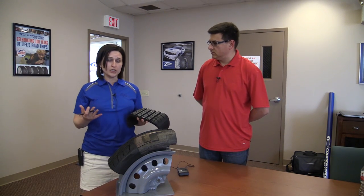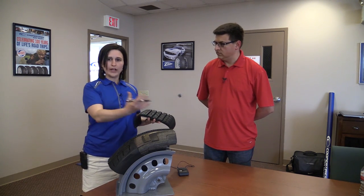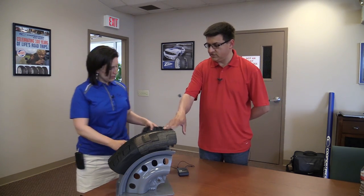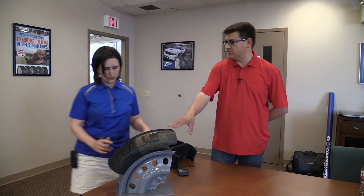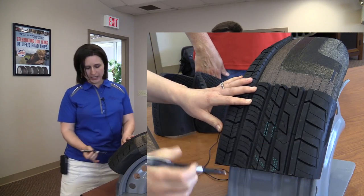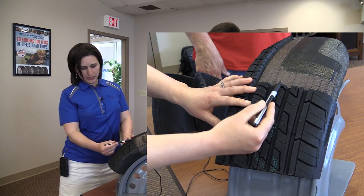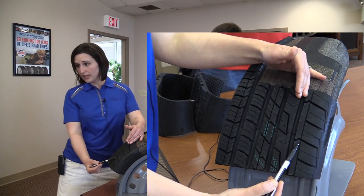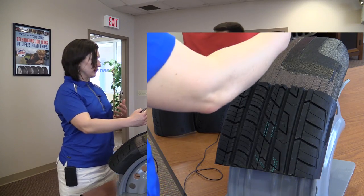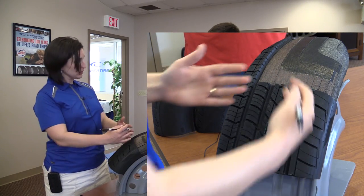On directional tires, that tends to be an issue because you cannot rotate it in all four positions — you tend to rotate them back and forth, so you don't get the even wear from all positions of the vehicle that you would on a non-directional tire. So even the W-rated versions of this — they're still asymmetrics, still non-directional tires, right? You can cross-rotate them. These are asymmetric, which means from one side to the other there's a difference in tread pattern. Directional means it can only rotate one direction, which gives it more of an arrow shape.